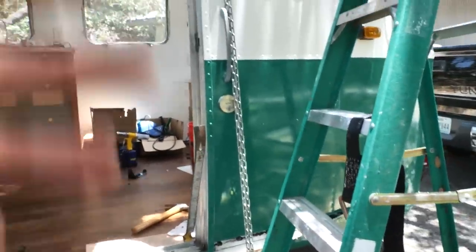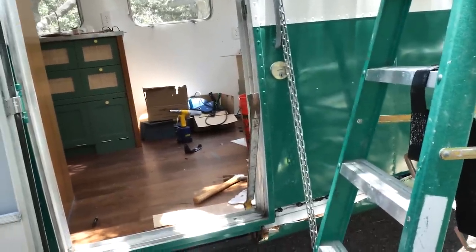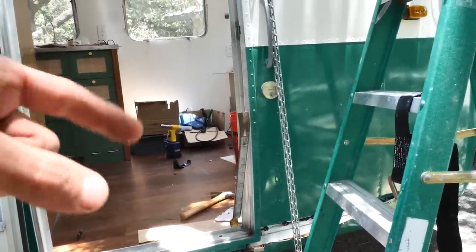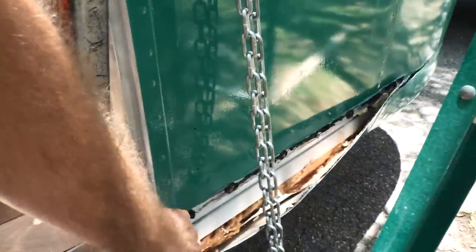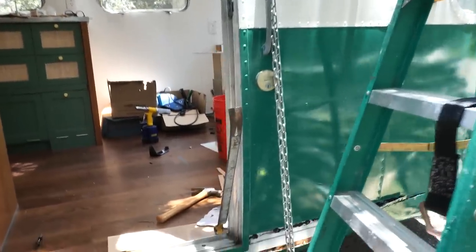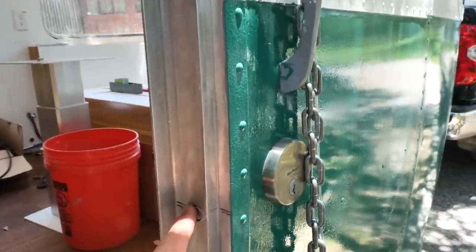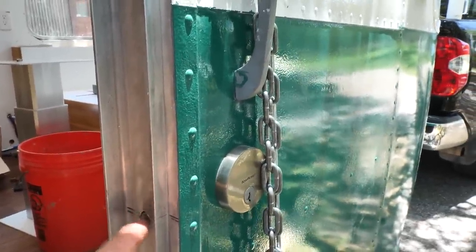And when we do that, if someone goes in the camper, pulls it back, and we look, it fits a lot better. So my dad has a much larger crowbar because we need more leverage. We need to get a little bit higher. So we're going to try to get more leverage on it, shim underneath here, underneath the jamb, and then get some new rivets all in along here and try to reposition everything. The biggest downside to this is the door lock that I took so much time installing probably now is not going to line up to the hole in the door, because we're going to move the jamb. It will move the door a little bit, but mostly we're just moving the door frame and leaving the door where it is.